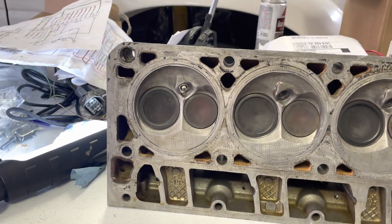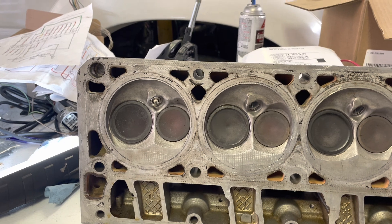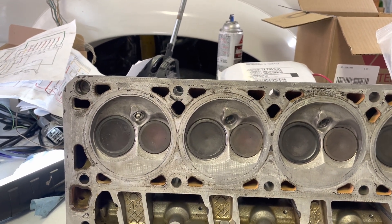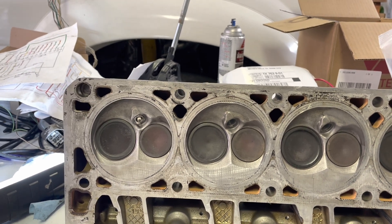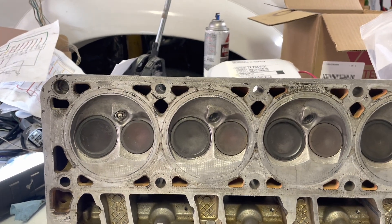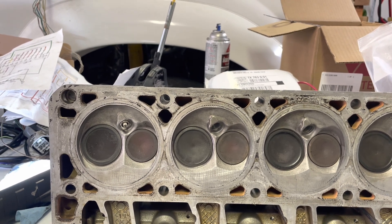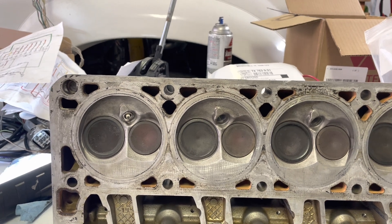It's this one here — and I'm not taking it out again, it's in there. I torqued it. I usually don't torque my spark plugs, but I wanted to make sure I hadn't removed too much material and that the threads were still going to hold that spark plug in there tight. So I torqued it to 11 foot-pounds per what I found online, and it's snug. It's in there good with just a tiny little drop of anti-seize on there, but she'll run another hundred thousand miles. I'm not touching it.